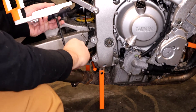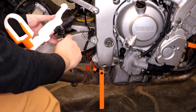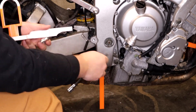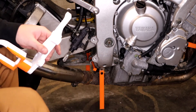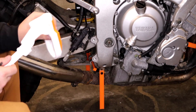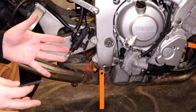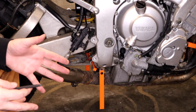Steel is also a lot more ductile than aluminum. While aluminum doesn't bend much before it breaks, steel has a lot of bend in it before it will actually break and fail on you. Off-road, you can deal with bent foot mounts and bent foot controls, but what you can't deal with is broken foot controls. So we're making everything so that if it hits something hard, it'll bend instead of break.